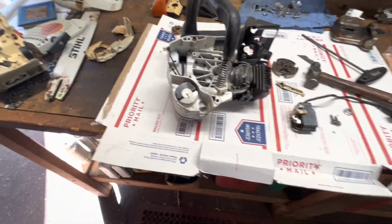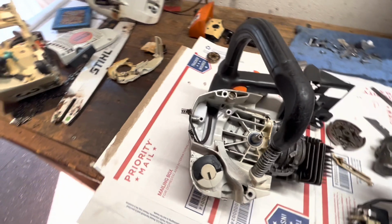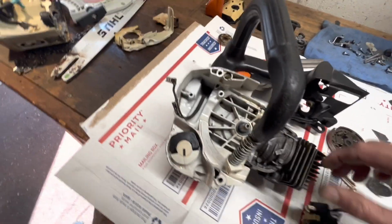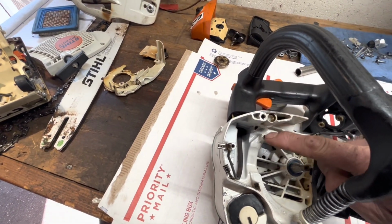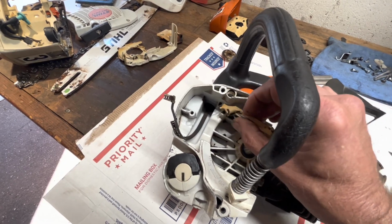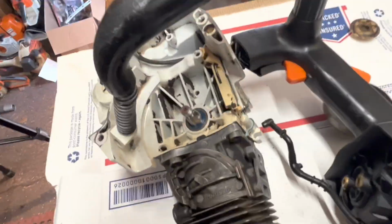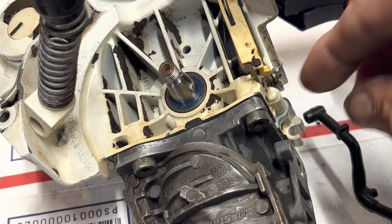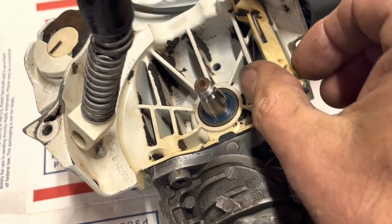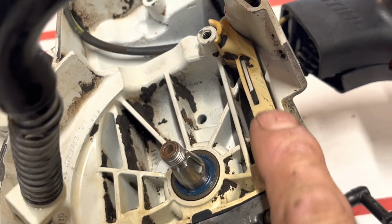All right, here we are back again. I just got the top handle laying on there. What I'm trying to do is, this wire has to be underneath. When we set the ignition coil in here, we're going to have to tuck that wire in back here, and then this shield goes over it and snaps in place. Let's zoom in. That right there has to be on the back side, so this will actually snap into place, and that becomes flush.